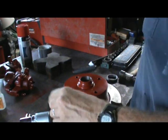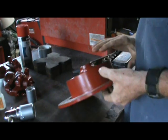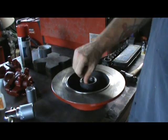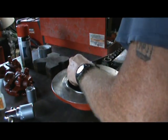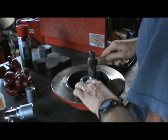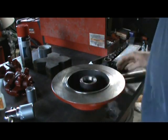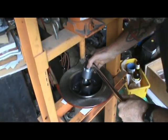I've got the larger socket set up to go first, so we're going to do the inner races first. I've cleaned everything up — any kind of paint or anything — cleaned the inside of the rotor. When you get those races cool like that, it contracts and makes it go in just a little bit easier. Let's get this over to the press and get this thing pressed in.